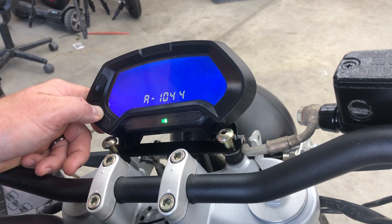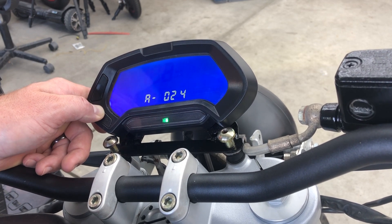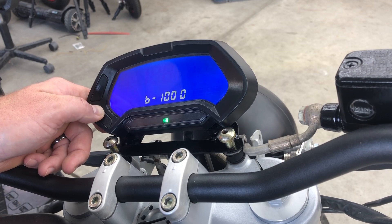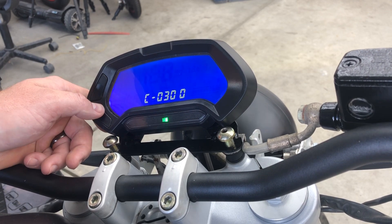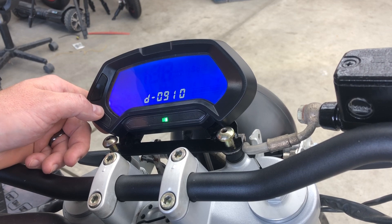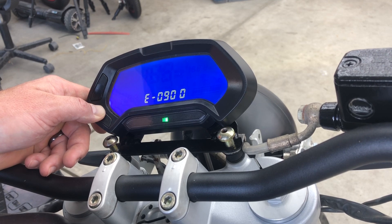Then the 80 percent remaining voltage — I'll drop that down by about 2.4. And then the 100 percent remaining voltage, I'll drop that down to 105. The next ones are for setting the 0 percent charging status — 91 volts is my 0 percent charging value. And the battery voltage for 0 percent discharge I have set a little lower; I'm going to move that down to 88, dropping it by 2 so that all my percentages match.